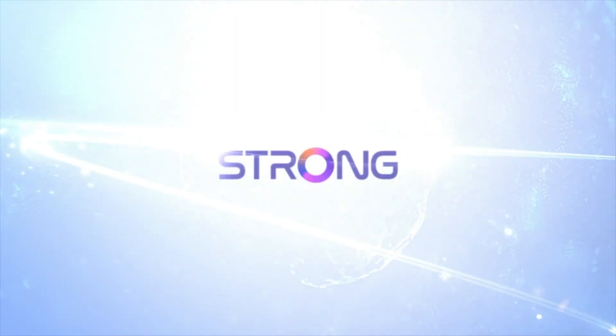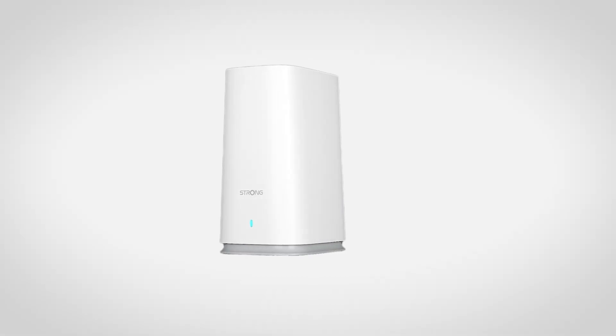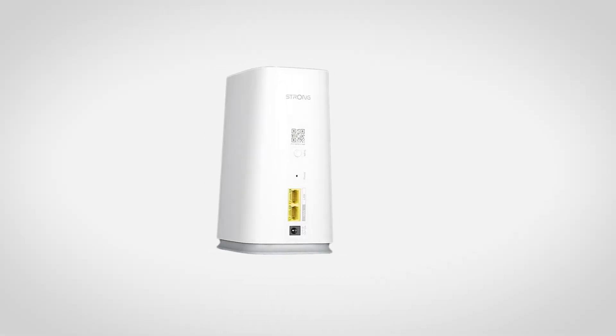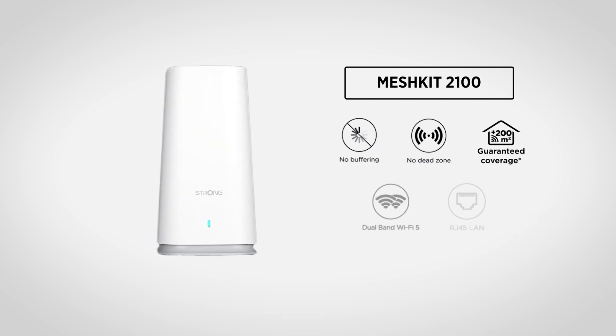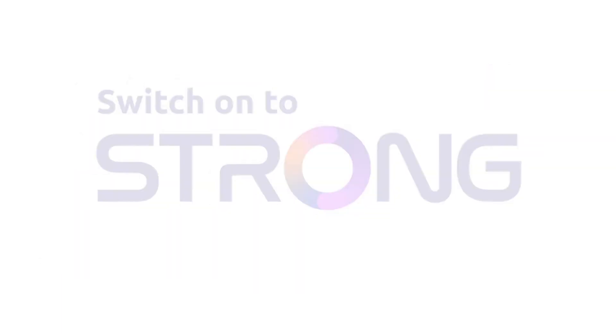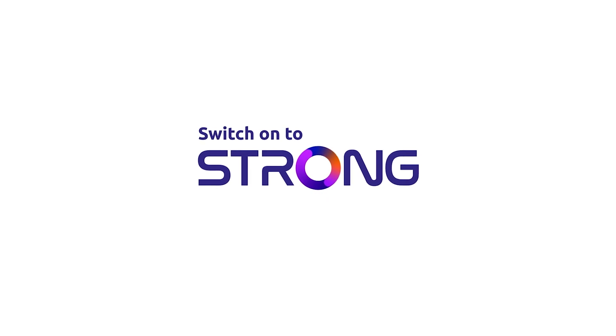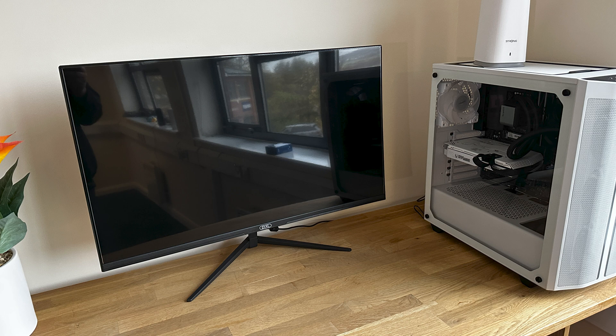So you may ask: what is mesh Wi-Fi and how does it work? Basically, you have a primary controller unit that you plug into your router or modem, and then you have other nodes around your home or office. These nodes talk to the main controller and each other, allowing each node to extend the Wi-Fi, creating a bubble around your house or office. When you walk from one side to the other, your device connects to the closest node so you don't lose connection and the chance of speed drops is reduced. A lot of people get mesh systems mixed up with Wi-Fi extenders, but a mesh system is more like a Wi-Fi extender times 10.